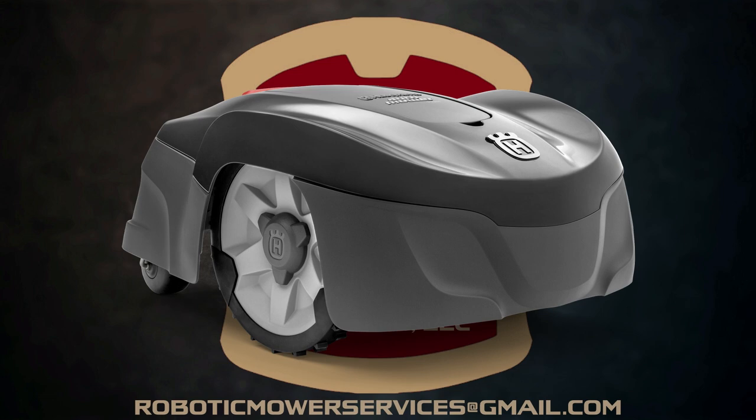Since first being introduced in 2019, the Husqvarna 115H automower has been a popular model with homeowners due to its lower price, its availability at more locations, it's a high-cut mower, and it's a fairly simple machine to operate. But it does have one setback, and that is its ability to maneuver up and down inclines. Husqvarna has a 17-degree maximum slope inside the installation rating on the 115H automower, while all other automowers in Husqvarna's lineup in North America have a maximum slope rating of 22 degrees or higher — a pretty big difference.